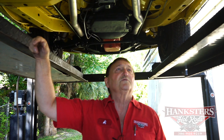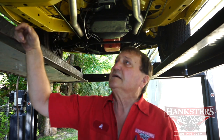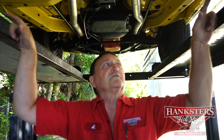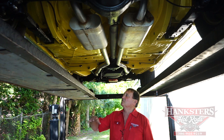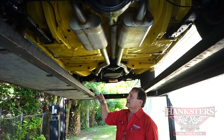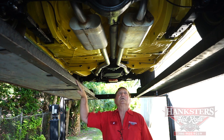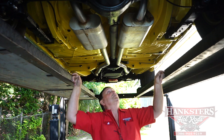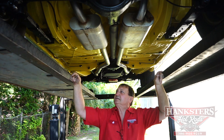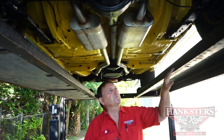This car is as fresh underneath as it was when it was new — without the splatter sound deadener that Chrysler put on them from the factory. This car is original tin, painted yellow like the rest of the car. Two and a half inch pipes transitioning into two Flowmaster mufflers. There's absolutely nothing negative to report on the front of this vehicle. From this vantage point you can see how well the undercarriage has been addressed — it was a total rotisserie restoration. The entire vehicle has been cleaned and painted the color of the car. Here are our Flowmaster mufflers — two and an eighth inch pipes going in, appearing to also be two and an eighth or two inch going out. New universal joint in the back. Drums in the front, drums in the back. Real nice arch to the rear springs with a nice stack on them.